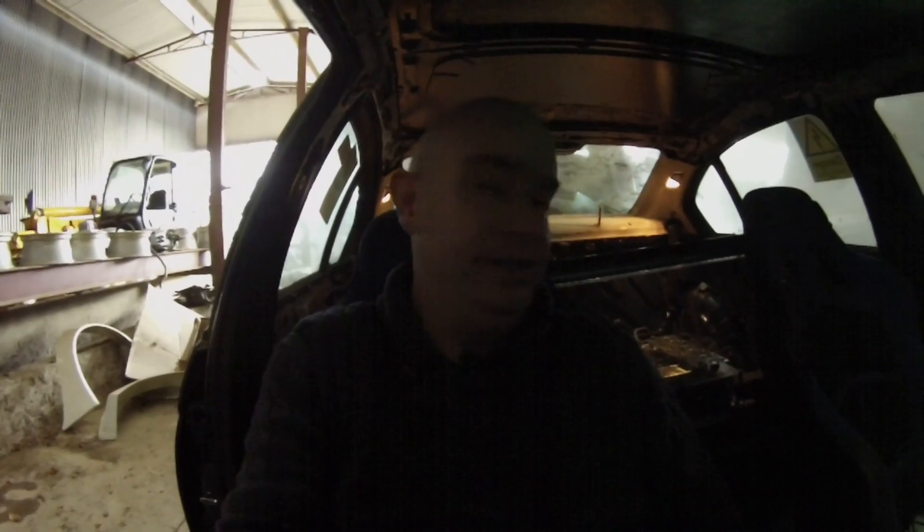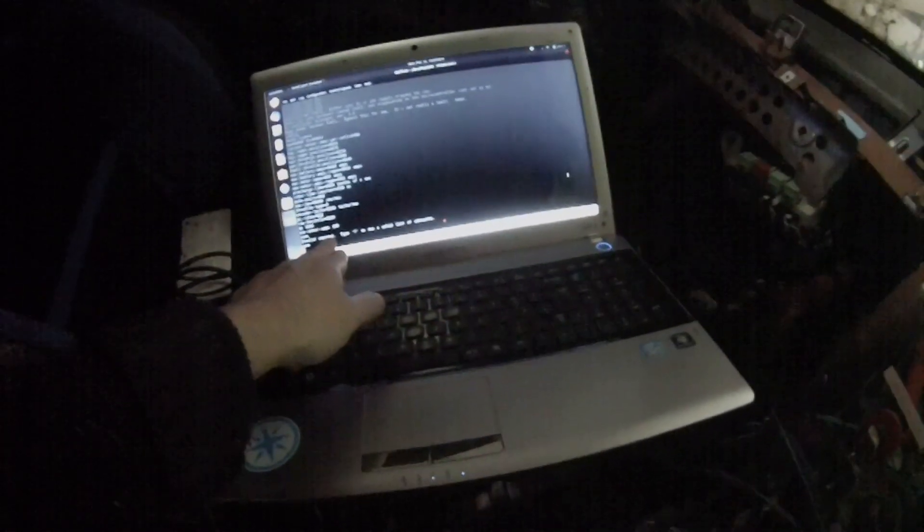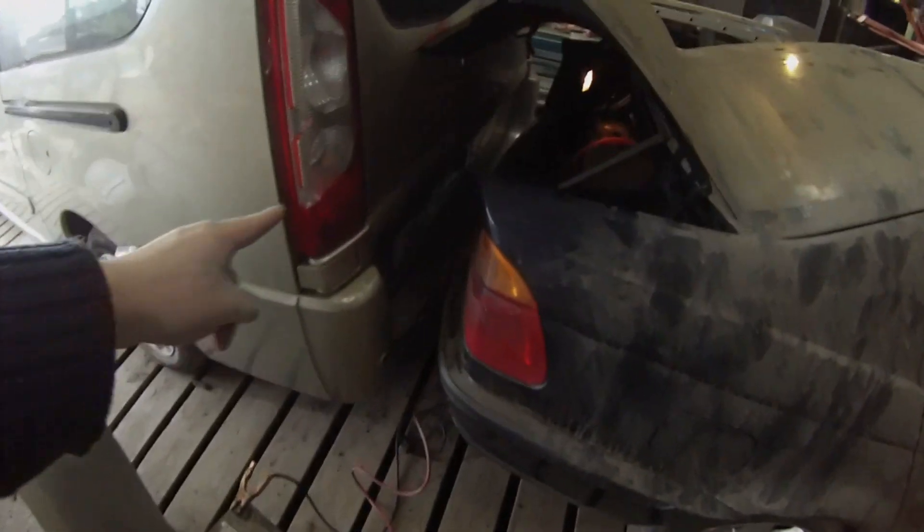Welcome to the inside of the super turkey. Our inverter is powered up and running with our laptop connected to it. We've got 150 amps of motor current, and the battery is at about 300 volts at the minute — it's not in a great position. When I give it some gas, we tend to start shaking, and the more throttle you give it, the more seriously it shakes. The problem is not really down to the inverter though.